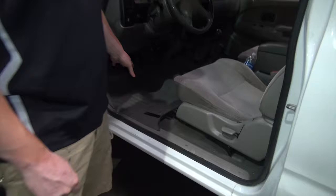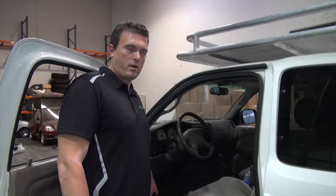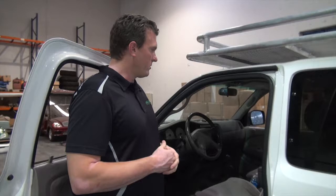The only interior mod I'm going to do, which I haven't done yet, is the gray wire mod. Since this is a TRD, it comes with a factory rear electronic differential locker that's only engageable in four-wheel drive. There's a ground wire to the controller that signals it's in four-wheel drive, and by modifying that, you can engage the electronic locker through the factory switch anytime you want — two-wheel drive or whenever. Besides that, I'll be adding electrical equipment for ham radio and navigation mounts like RAM mounts.